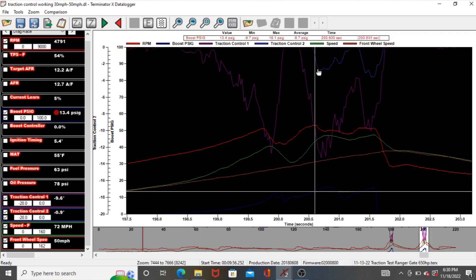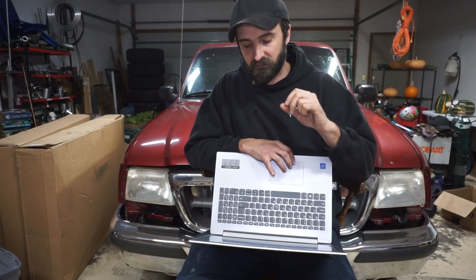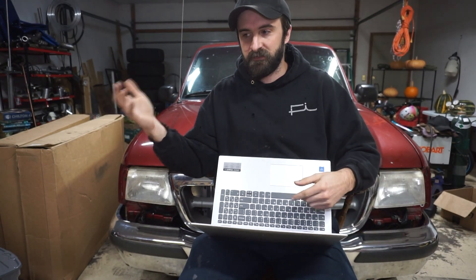On this section at a little bit higher speed, the blue line shows it's actually starting to use traction control 2. I have two tables set up — one works up until about 70 miles per hour, one starts to work at 70 miles per hour. Right at 50 mph front wheel speed it started to use that table because I had it set to activate at 50 mph. So I changed the second table to activate at about 69 to 70 miles per hour. It seems like it starts working in anticipation of that table coming on. You can see traction control 1 is working, traction control 2 is working — it's pulling 11 degrees on traction 1 and trying to transition to the other table, but I didn't stay in it long enough to fully transfer to the second table, which would be above 70 mph with wheel spin.